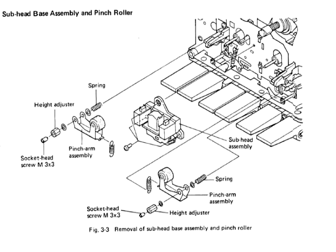If the TU belt is bad, you're going to eat tapes. Maybe the TU belt is loose — mine was deceptively slack. It appeared to be doing its job, but it wasn't. In the reverse capstan, it'll eat tapes before the forward capstan does. It's just because the uptake reel isn't turning and the capstan wheels are. As you might guess, it's going to feed that tape through at 15 inches per second, and it's going to just wrap around these capstan wheels.